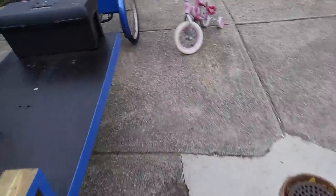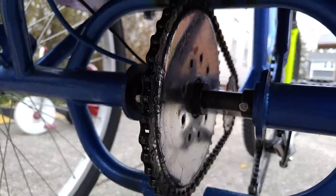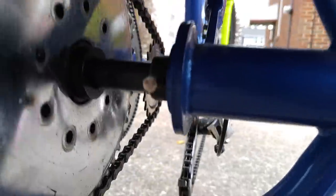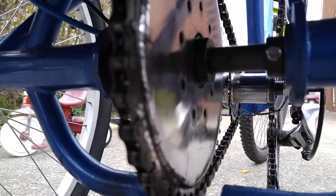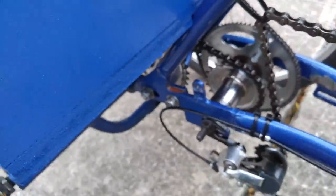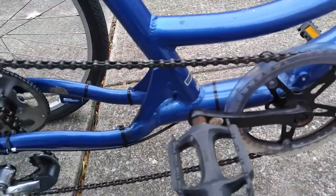I think that's just about all the updating I've done so far. I have already pre-ordered everything for building the differential back here. I've ordered two freewheel adapters that'll go one here and one here, two freewheels, and there will be mounts that bolt through these bolt holes through the freewheel. This axle will get cut down the middle so that both of my tires become drive tires. There's also a three-speed — 16, 18, 21 — that'll be threading onto there shortly, which will allow me to assist it through different speed levels.